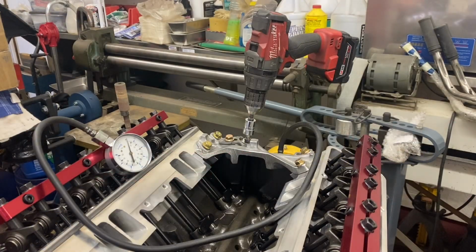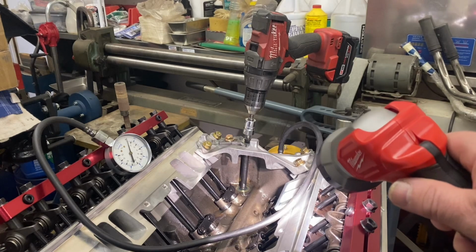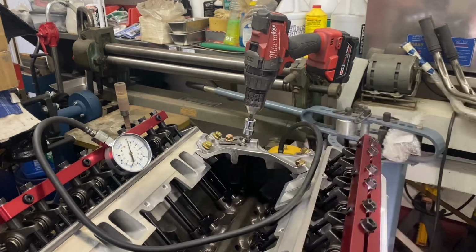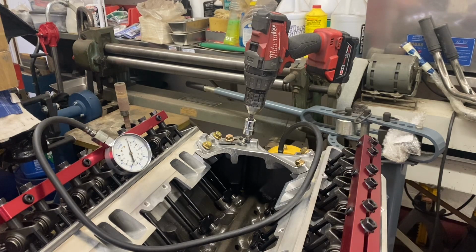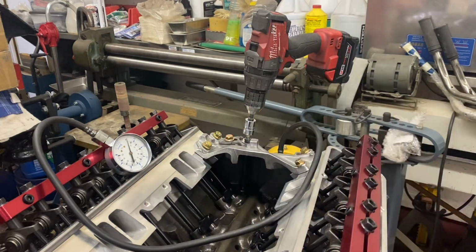Here's my oil pump primer setup. You can build your own primer out of a distributor housing and a shaft with the gear removed. You cannot use, with any great success, just the rod that drives the oil pump, without an aluminum piece or your distributor housing that fits in the block down near the camshaft, to distribute the oil down the cam tunnel. You'd have a massive leak without either that adapter that's part of my oil pump primer or a distributor housing, because that redistributes the oil. In fact, a lot of aftermarket distributors have an O-ring upper and lower to help seal off that passage.